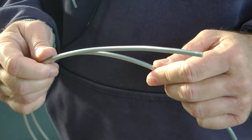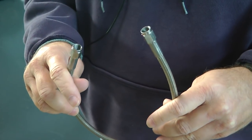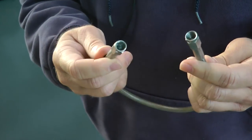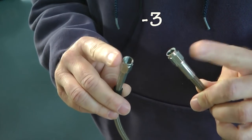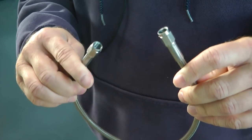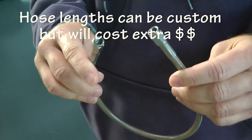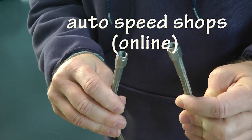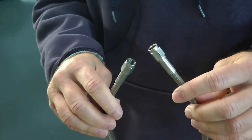Versa Tube is about 50 cents a foot or less — you really can't beat it and it's sure nice to work with. Next we need flexible brake hose. This has stainless steel braid on the outside, and the ends are pre-assembled with 3/16-inch or dash-3 connectors for hooking up to dash-3 flare fittings. These come in standard lengths — 6, 12, 18, 24 inches — and can be made to custom lengths. They're available at most auto parts stores, especially racing supply stores, for about $10 each.